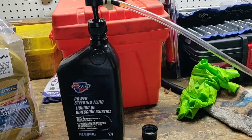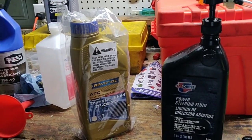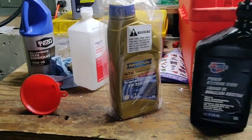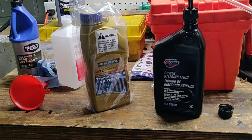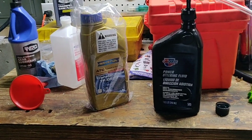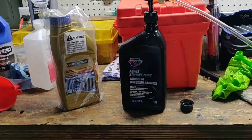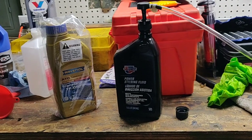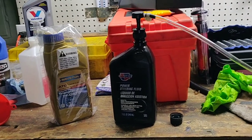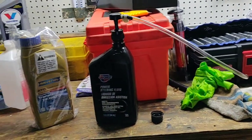Normally I like to change dirty oil and then drive it and then immediately change it again — I just didn't have time to do that today. It drove fine, just a quick follow-up. As you saw, it was very dirty. And there are a lot of people who talk about having to reset some setting on the BMW computer to force it to relearn the settings for the transfer clutch. I'm convinced that only applies to a situation where you either put in a new transfer case clutch or a new transfer case — I don't see how it applies for a maintenance item like this. Good luck.